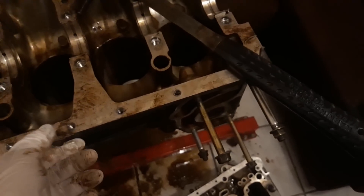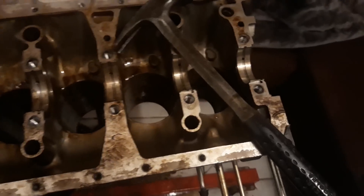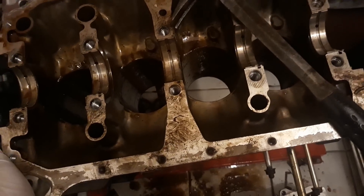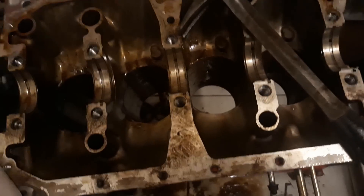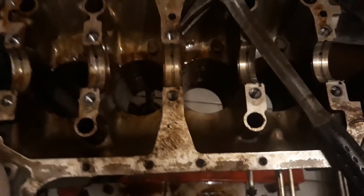I don't have to worry about turbo or anything like that, and I already have a K24 A2 head stashed over there. So the plan is: K24 A2 head on this K24 A4 short block, with K24 A4 rods on Super Tech 12.5:1 compression pistons. I may upgrade the cams — not 100% sure yet — but the goal is 240 to 250 horsepower.